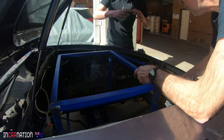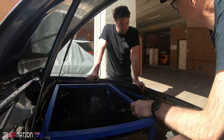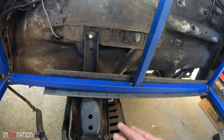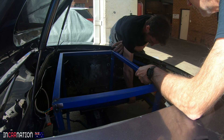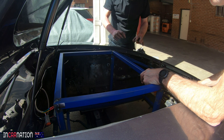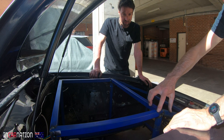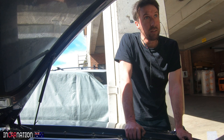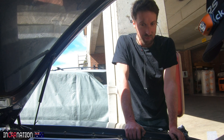We're supporting the battery box here but it's still going to want to flex. We were talking about just bolts at each corner but it'll be hard to get in and under it. The plan is a rail — put a rail all the way forward on both sides so it can't rock, can't go sideways, and absolutely locks it in. We're supporting along the whole width front to back. We can add rubber strip for a bit of give if we want. The engineer's going to love it — it's a proper thought-out process: secured at multiple points of contact, not just ratchet straps from Bunnings.